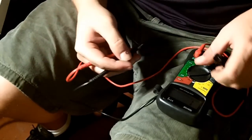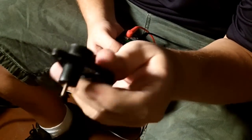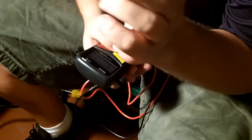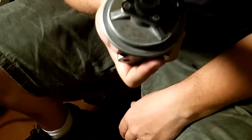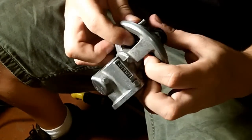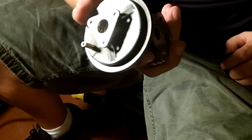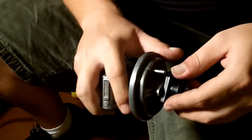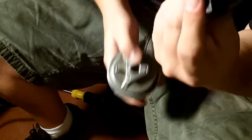So again, it's low. All of the readings coming out of this EGR sensor are too low, out of spec. Out of spec in some respects by a lot. The first thing that I was doing was testing it in place, and I was like, why am I getting readings so low? So I decided, well, it must not be fully depressing, right? That's what's messing up my readings. So I took it out, I cleaned the whole thing, I put back the sensor, and I tried doing the readings again. Of course, they're still going to be the same. So I was like, well, I can just take the sensor off and read it that way. And of course, all of the readings were the same, either in the sensor or not.